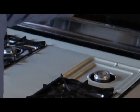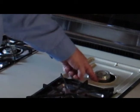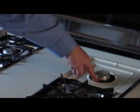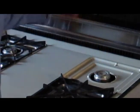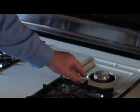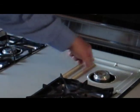If you've ever boiled potatoes or something and had it spill over, the starchy water spills over here and covers the holes. When you turn the burner on, the gas comes out of here but doesn't come out these holes and can't travel down the little tube, hit the hot spark, and come back. The easy fix is just to take off the grate — which we've already done here — and take a needle or something sharp and clean out the three little holes so the gas can again come out, travel along the tube, hit the hot spark, and ignite the burner.